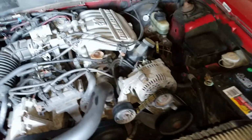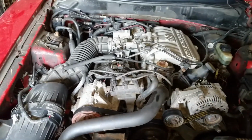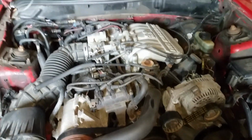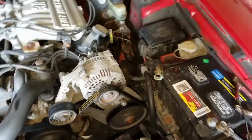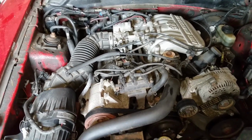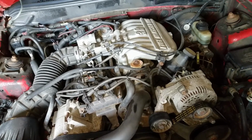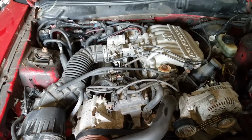Normally you'd warm it up and then drain it, but I'm not going to. It's been sitting all those months, and all the oil is basically drained down, other than what's lubricating the walls of the cylinders and the cranks and the cam and everything that gets oiled. So basically I just jack it up and let it drain for a couple of days. That'll get everything out of the pan. I'll put a little bit of new oil down through there, and it'll push all the old stuff out. Put the new oil filter in, and then crank it a couple of times. Not let it run completely, just enough to get the oil pumping up into the valve heads, and then finally let it run and idle up.